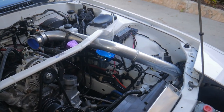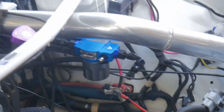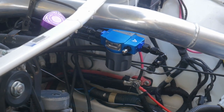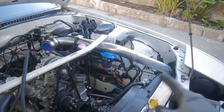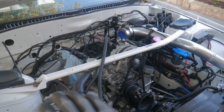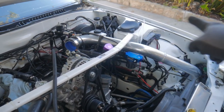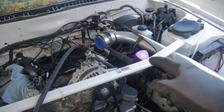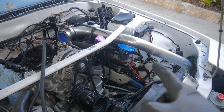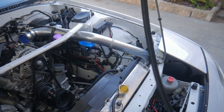The bracket is finished. Three holes on the front will hold the fuel filter in place, one bolt on top, one sliding fitting on the side which bolts down as well. Now we're going to clean it up and paint it so it looks nice in the engine bay. While that's drying out back, I've got this mount mocked up where I plan to mount it — just zip-tied in there right now. This lets us go ahead and make the fuel lines, get the injectors back in, then bolt it all up and fire up. The fuel filter goes here because there's space on the cold side — I don't want too much over on the exhaust, turbo, and downpipe side. It's also easily accessible, and the fuel feed comes right up from there, with the fuel return going up on top of the engine block.